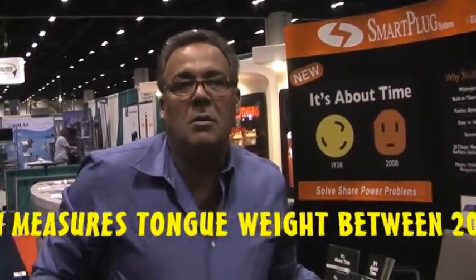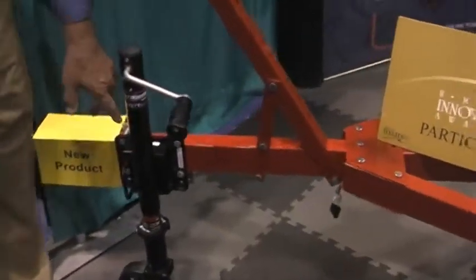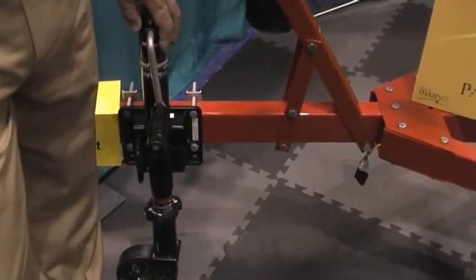When you're going down to your local fishing spot, you load up your boat like you usually do and you know it tracks well down the highway. But when you're going to a different spot, you often use your boat trailer as a storage trailer — adding a tent, extra coolers, some additional gear. That additional gear adds weight and transfers it to the tongue. We recommend recalibrating the tongue weight by removing some of that gear and putting it in the back of the SUV or pickup. It's a safety feature to make sure you're driving safely on vacation and that your trailer's not fishtailing all over behind you.